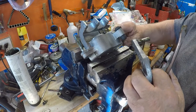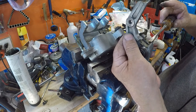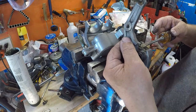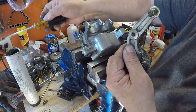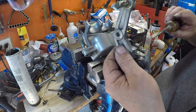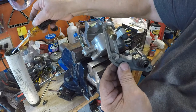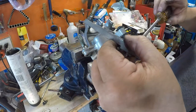Right where the brakes set in here, I'm putting a little bit of grease — just a little film of it. I had some regular brake grease; you can get it in little packs at the auto parts store. A lot of times when you buy brake pads, they'll give you a little package of grease to put in. I'm going to put some in this rubber cup too — that'll help feed the grease to it whenever it works. This is just time consuming doing everything right, but hey — take it to a dealer and you know what you're going to pay.